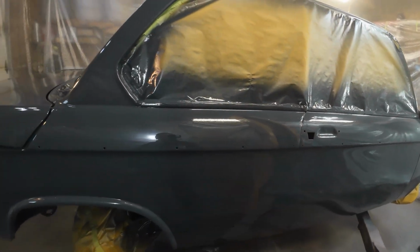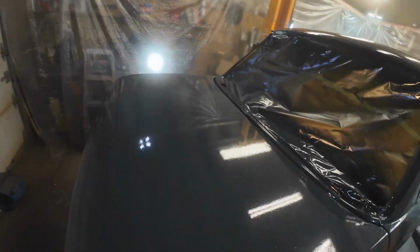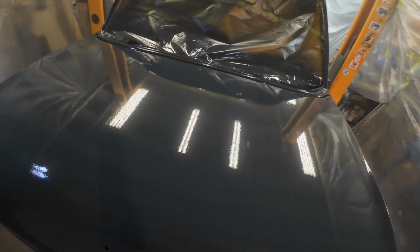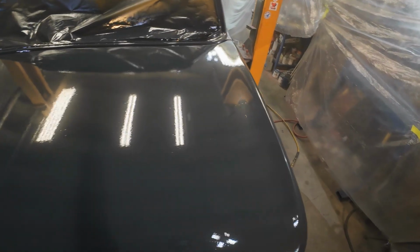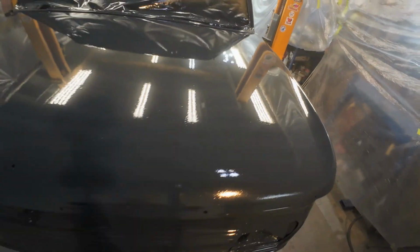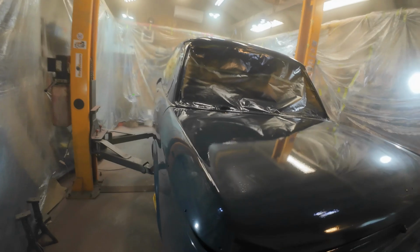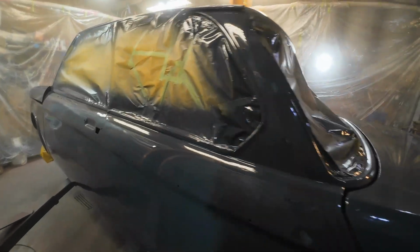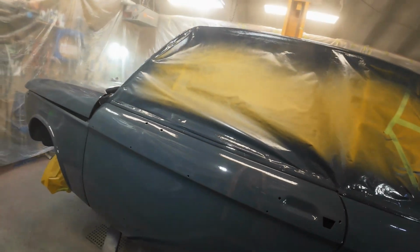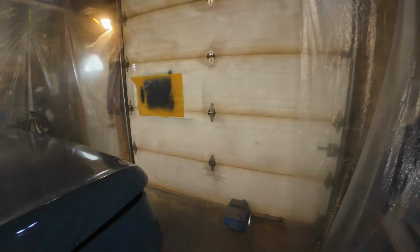Yeah. Okay, so here's coat number 1 on it. I think it looks pretty good. There's a couple of spots on the back here when I was painting. You can see underneath the sanding swirls, but they're right there. Don't know if you can see that or not. Hopefully it gets covered up by the time I get the clear coat on. Most part it's pretty good. So I'll let it sit for 15-20 minutes and I'll come out and see about another coat.